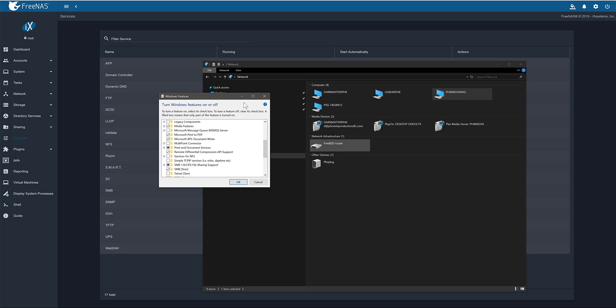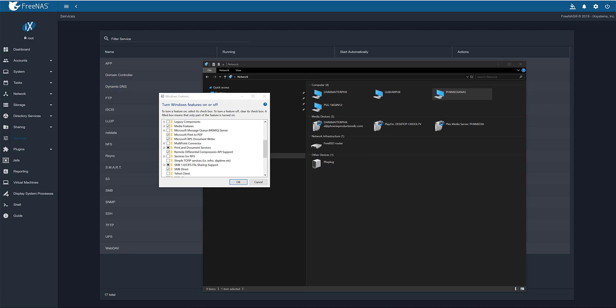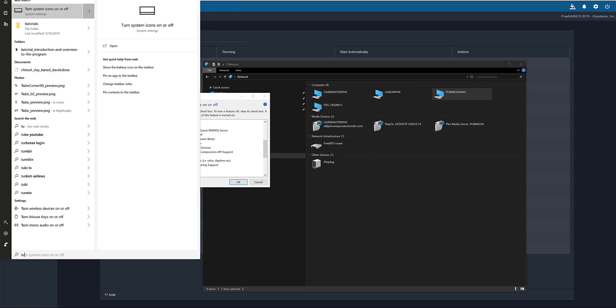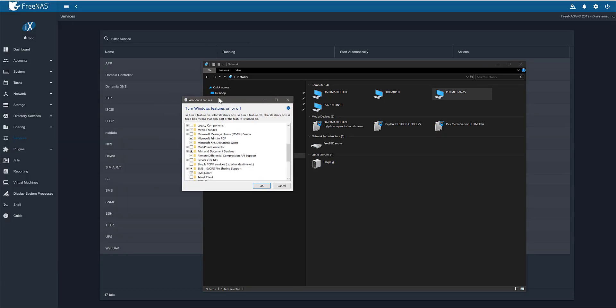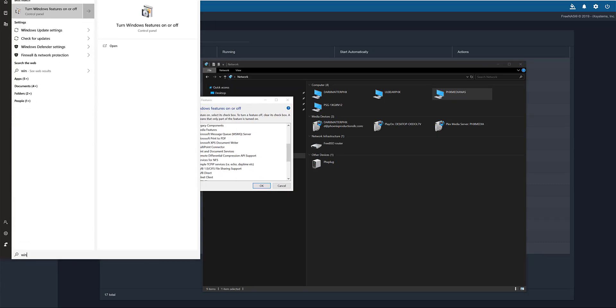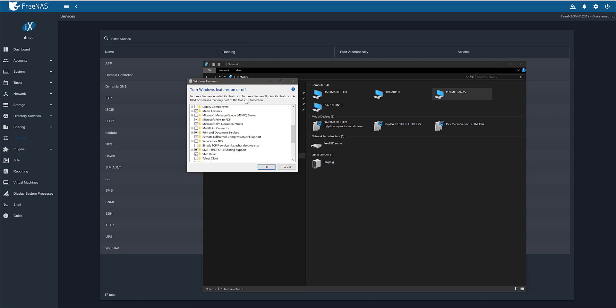If that's happening, go to Windows and look for 'Turn Windows features on or off' in the control panel. When you open that up, you'll see that there is SMB 1.0 CIFS File Sharing Support. This will be deactivated by default now with Windows. I don't know why they decided to do this, but they did, so you wouldn't be able to see your network shares.